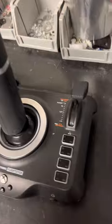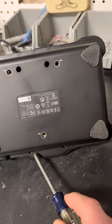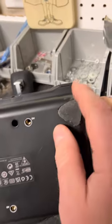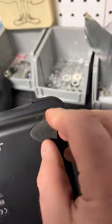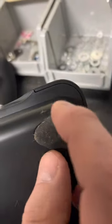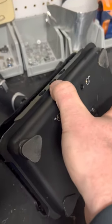On the back side, first four screws — one, two, three, four — and then four secret screws behind these rubber pads. Just peel it back a tiny bit so you can get to the screw; don't rip it all the way off. On all four corners you'll have four more screws, then this back plate will just come right off.